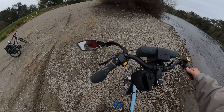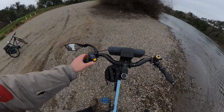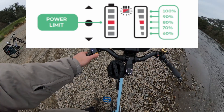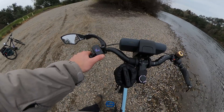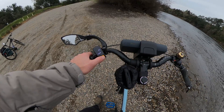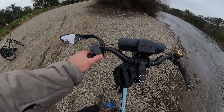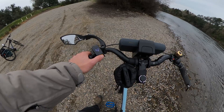One tap gets you to your pedal assist mode. Each of the P-modes are different pedal assist modes — it goes from zero, where in pedal assist mode zero there is no throttle available, up through pedal assist one and higher where throttle is available. Throttle is supposed to be 60% of your top speed. To get into the menu, you hold the button until just the Bluetooth button is showing on screen. The first setting is miles per hour versus kilometers, and the second is wheel size. Top speed goes up to 32 kilometers per hour in the settings.